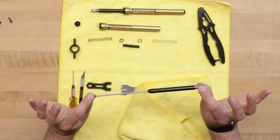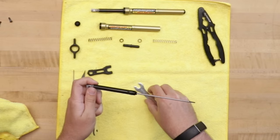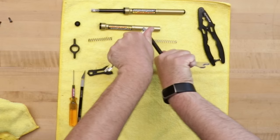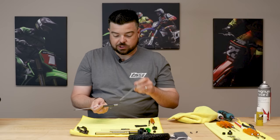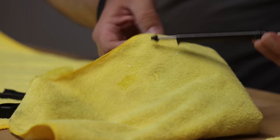To unscrew this we're going to use our fork wrenches — there's a nine millimeter end and a six millimeter end. The six millimeter end goes on the bottom and the nine millimeter end goes on top right here where you can see some flats just underneath the black bushing. Key it in there and loosen it up. These are fairly tight — done intentionally, it takes a lot of leverage. They're tightened to 12 newton meters, just the right amount of pressure to keep them from coming undone while running. Then I'm going to dump out the dirty oil onto the rag, slowly push the shaft down, and you can see the piston. We'll pull the shaft all the way out.